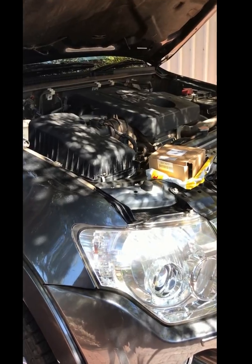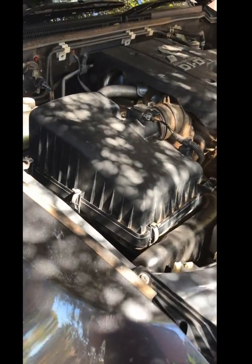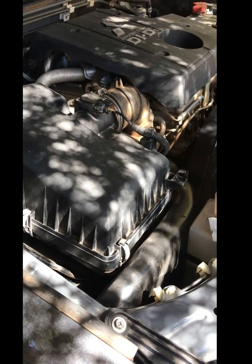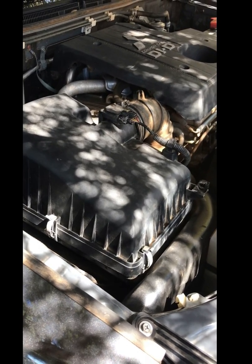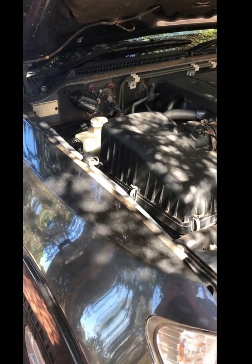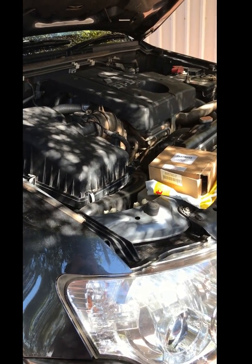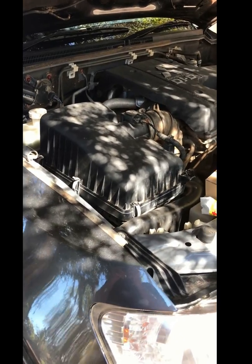This is an NW 2013. I removed the air filter, and underneath that there are two solenoids. One of the solenoids is not working. There's one for two-wheel drive and one for four-wheel drive, and they create a vacuum. With somebody inside the car and the engine running, changing from 2H to 4H, you can feel the vacuum coming through the 2H solenoid — but when it changes to 4H, nothing happens.